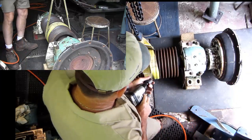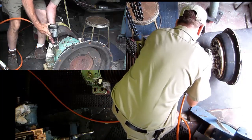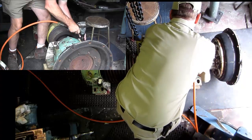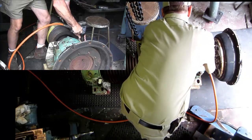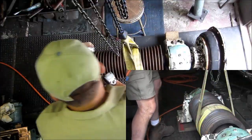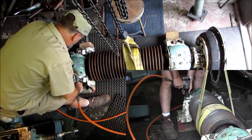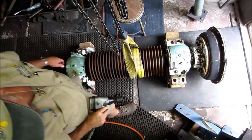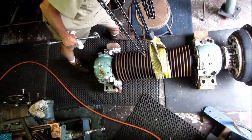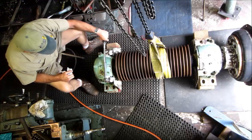Alright, let's go ahead and pop these top cap bolts off. They're pretty tight — we might actually have to break these with a breaker bar, and we'll record what those torques are. I'm sure they have a torque spec in the book as well. Alright, I'm going to grab my tool here and make sure we're high enough to clear that bearing right there.